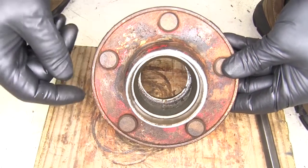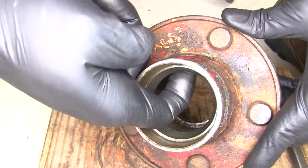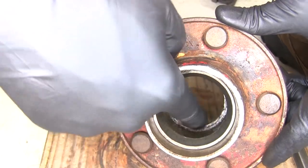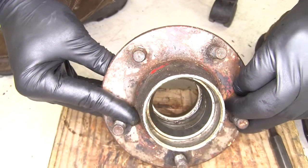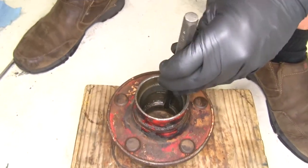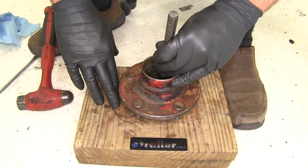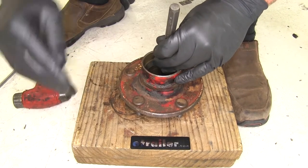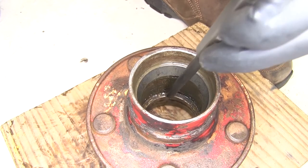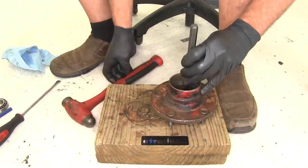With either method, we need to tap on the back side of the race. You can see this front race — it goes in and there's a little lip behind it. We're looking at the back of another race; you can see this lip right down here — that's going to be our inner race. So we'll start by getting that one out. Place your punch or screwdriver, and whatever surface you're working on, it's a good idea to have a block of wood to keep the metal from hitting concrete or digging into grass. Bring your punch down so it sits on the back side of that race, and we'll begin tapping.